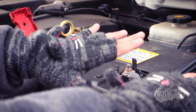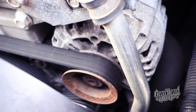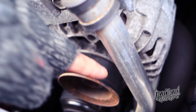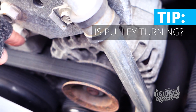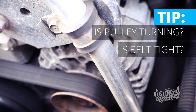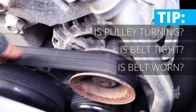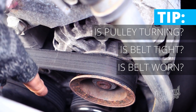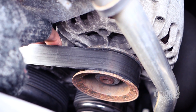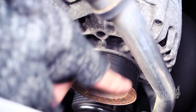Next, look at the alternator itself. While the car is running, make sure the pulley is actually spinning and the belt isn't making any squealing sounds that could indicate it's loose. With the car off, get a better look at the belt — make sure there are no cracks and it's not excessively loose. Your problem may not even be your alternator; it could just be that you need a new belt, because a worn belt won't provide the clamping force necessary to properly rotate the alternator pulley.